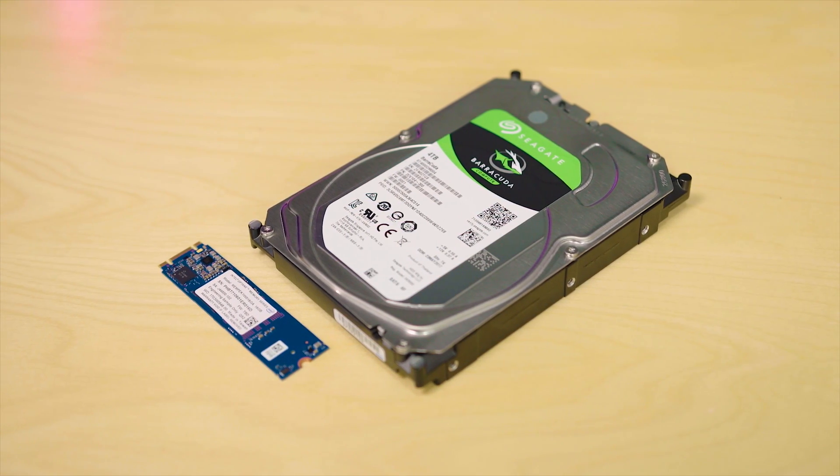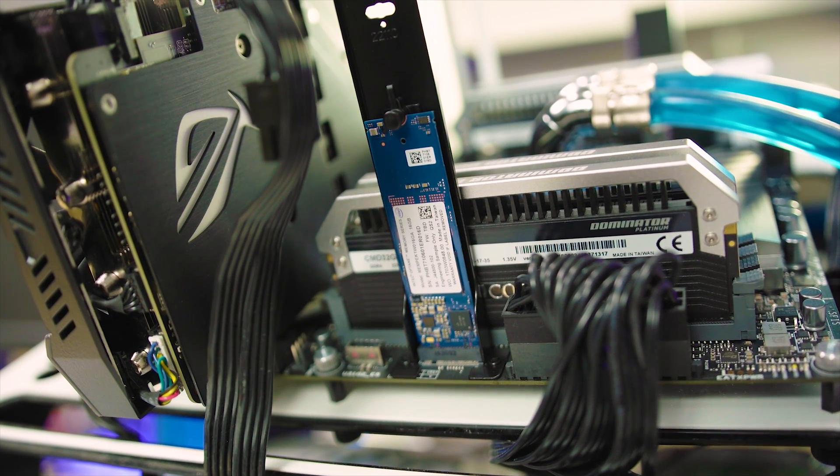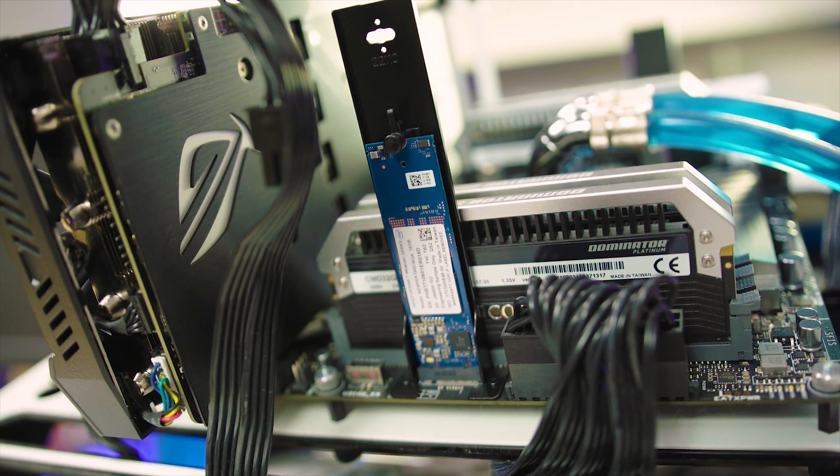For about $170 total, you're able to get massive amounts of storage at the speeds of an SSD — not bad at all. One important thing to keep in mind: Optane can only accelerate whichever drive has your OS on it. So if you have multiple hard drives — games on one, OS on another — it's only going to accelerate the OS drive. For people on a budget who want mass storage and good speed, it's definitely worth taking a look at. The speed increase and time decrease for opening programs, restarts, and shutting down Windows was extremely tangible — no margin about it. Huge thanks to Intel and Seagate for sponsoring. Links are in the description. I'll see you in the next one.